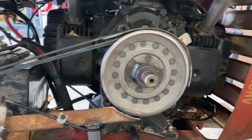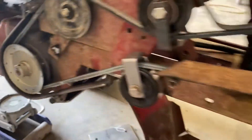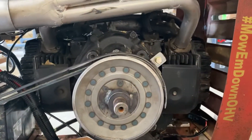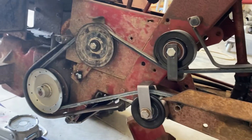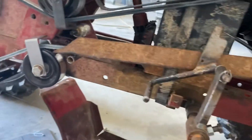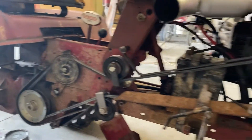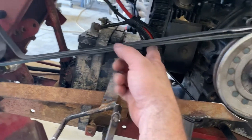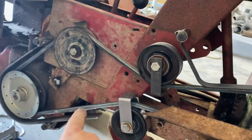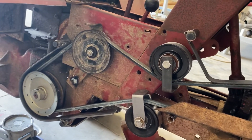Kind of off-subject, but I run a 7-inch engine pulley and a 5-inch on the transmission with 26-inch tires — souped up 18-horse Briggs, a POS twin. It'll run 20 mph, but I would not want to hold it there because that thing is really winding up and it's got stock rods and flywheel. That's the setup, folks. Again, you have to have your belt guards of some way, shape, or form on here — and a way to stop this belt from moving — or you're pretty much screwed.